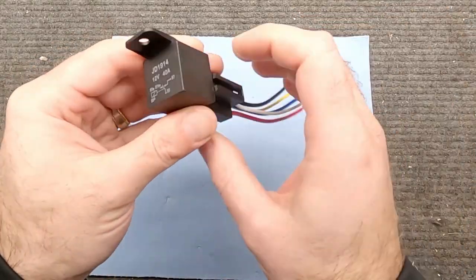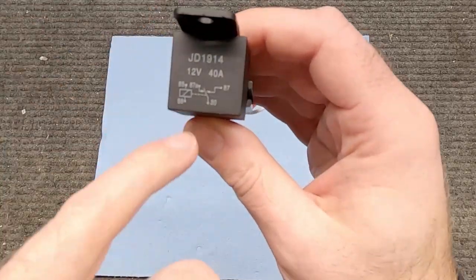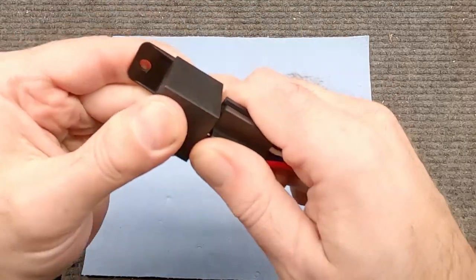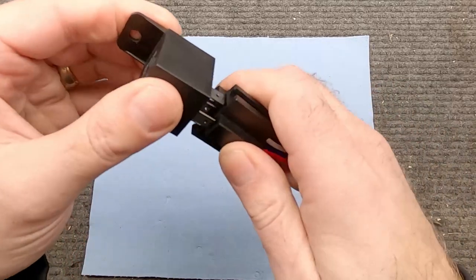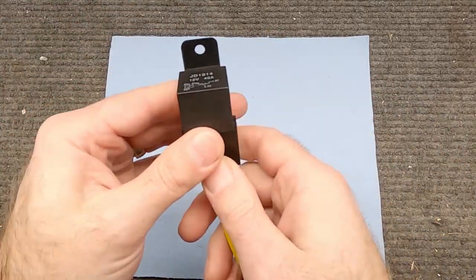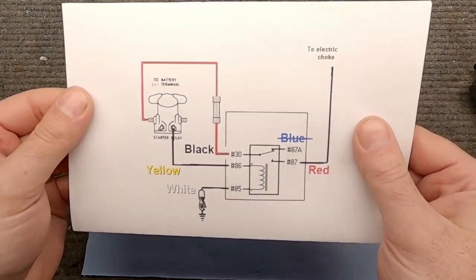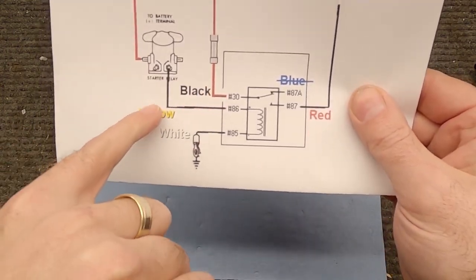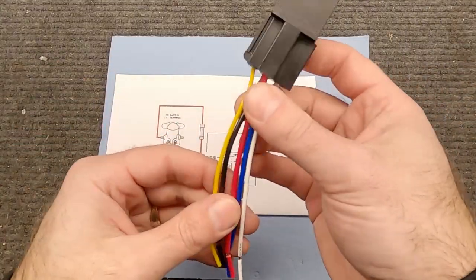To hook up that electronic choke, using a standard relay like this is perfect for what we need to do. You may have seen this type of relay before. These are standard terminals here and you can buy just the relay itself and put the spade terminals on there, but I like having this harness — it just makes it a little bit easier and it's a cleaner setup. To power this thing, we're just going to come off of the starter solenoid. I found a drawing online that basically lays this out for us and I ended up adding the color of the wires to which ones we need based off of this harness.